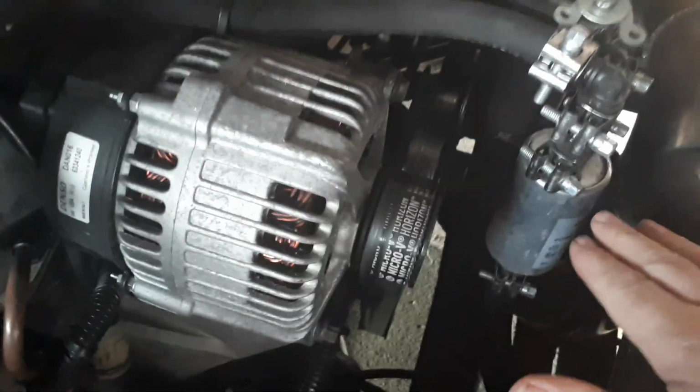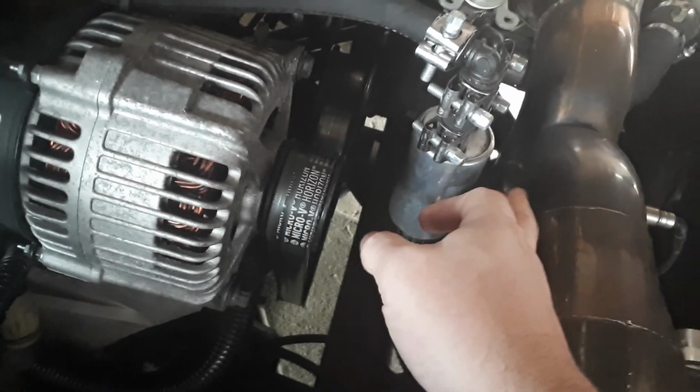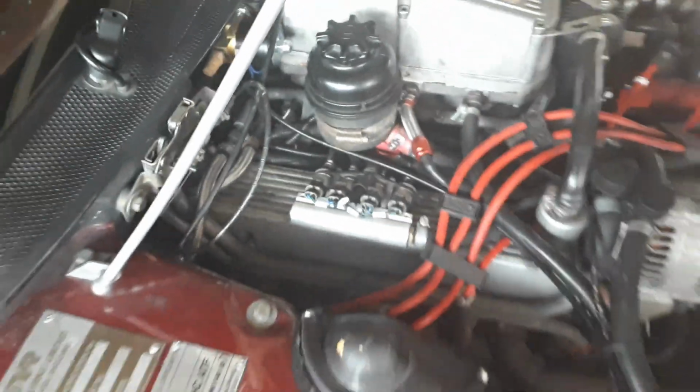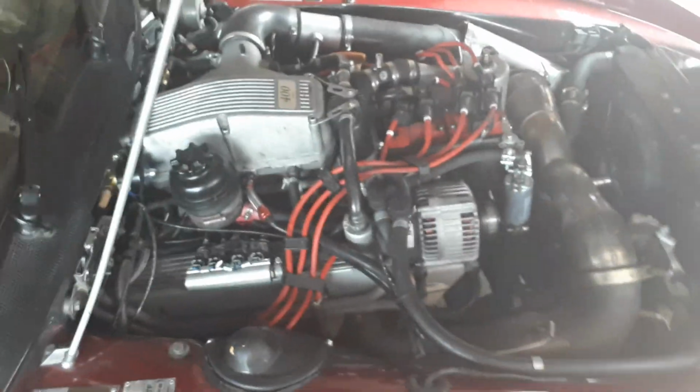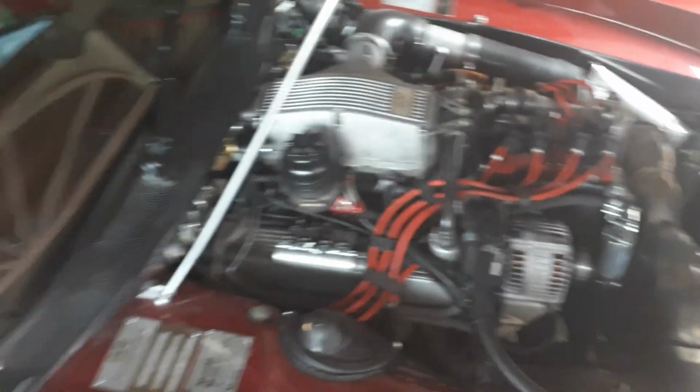And then draw your attention to the filtration system here that I've mounted just forward of the exhaust, and we'll come back to that in a minute. Okay, here are the offside bank of injectors. So they're sitting on the rocker covers. They take a little while to warm up, but they do get radiant heat from the rocker covers once the engine warms, which helps again. So as we all know, you can't really start an LPG car, of course, in the cold and wet like this. But we're going to prove you actually can.